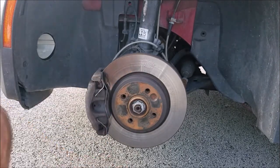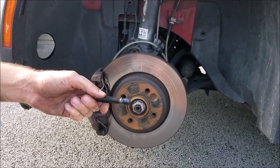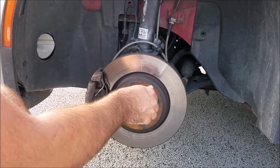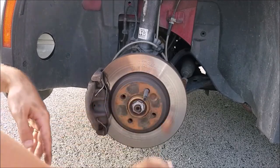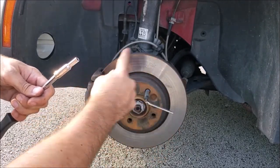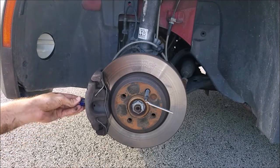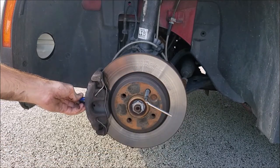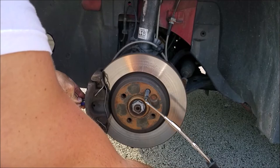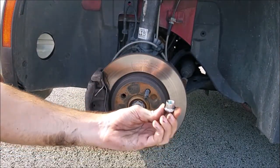Now that we have everything out of the way and the car is jacked up nice and safe, we're going to take one of these studs, apply just a little bit of the medium strength thread locker — just a little dab, not a whole lot, just enough to make sure it's not going to go anywhere. Get it started by hand. Once it bottoms out and you can see we're starting to turn the rotor, use a screwdriver to trap the rotor so it can't move, then tighten this down. It doesn't take a whole lot. We'll do that three more times, then get the wheel on and torque it down with our nut to 90 foot-pounds.